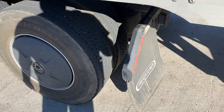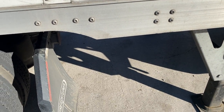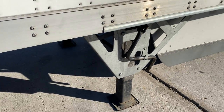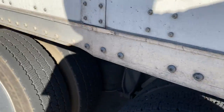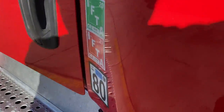If you're fortunate enough to have the release airbags or the dump airbag button on your rig, then this will help immensely and I'll show you how in a bit. Essentially you want to put down your landing gear so it lifts up the trailer a little bit. By the way, this is for the Freightliner, like 2016, maybe 2018 and up.